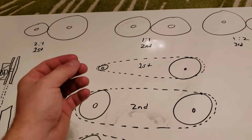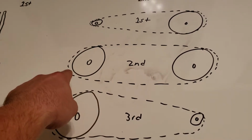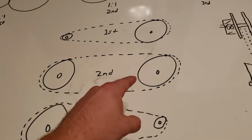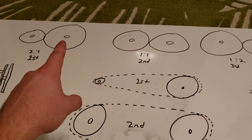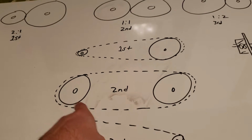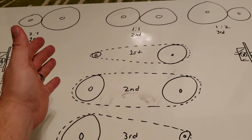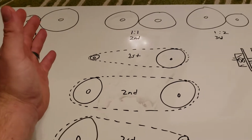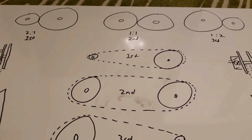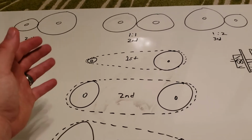Then as you go up in RPM, the front pulley contracts, comes together, making itself bigger so that the belt has to go around a bigger pulley, and the rear pulley is expanding, going from the biggest it can be, like up here, and it's getting smaller. And we're going to say right in the middle, they're the same size, just like we have here, and that would be a 1-to-1. So for every 1 turn of the front, there would be 1 turn in the rear. So the engine would have no advantage. It would be 1-to-1. So this would be your slow moving kind of cruising speed. So the engine's not working too hard, but it is speeding up. You're going to notice a speed in the golf cart.